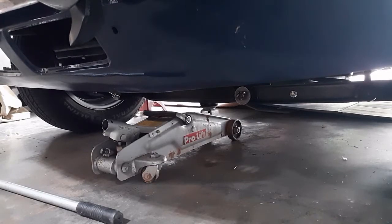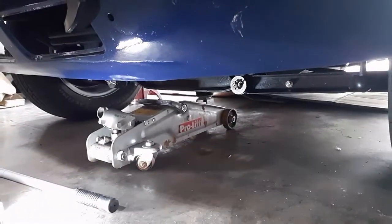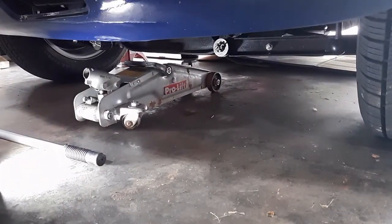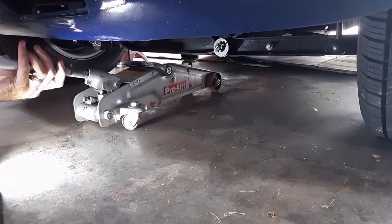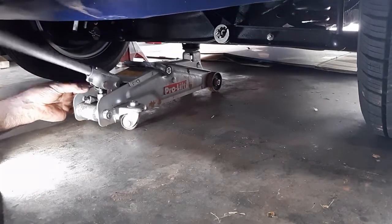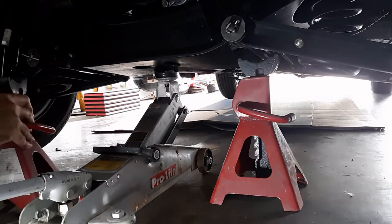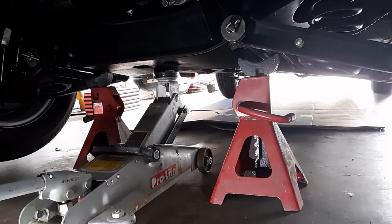What I'm going to do next is jack it up a little bit in the front so we can get in there to the oil pan easier. To jack up the B, the easiest thing is to get your trolley jack under the crossmember towards the back side of the car in the front. I've already rolled mine in — lock it up and pump it up. Then for safety I'm sliding jack stands underneath the front as well.